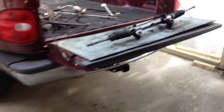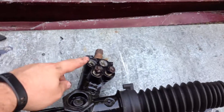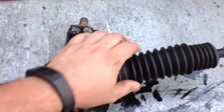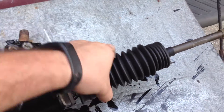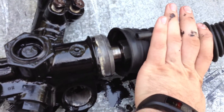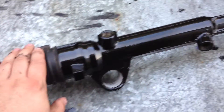I'll show you my steering rack over here. So this was pretty easy — I cleaned it up, I took all the lines off of it. I reused the boots because they were in good shape. But these are the new tie rods; they were pretty easy to change. I did it on both sides. I've got to torque them down and finish putting it back together.